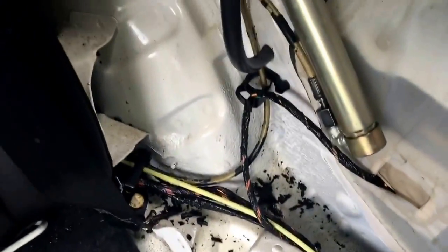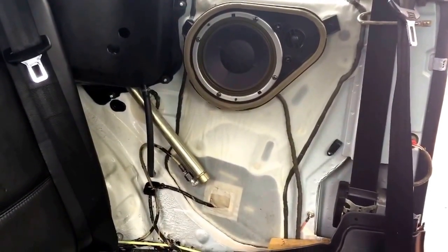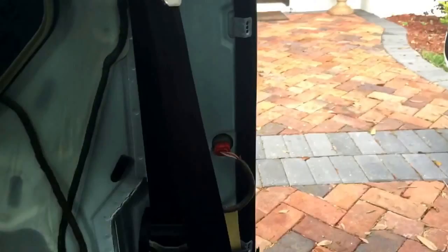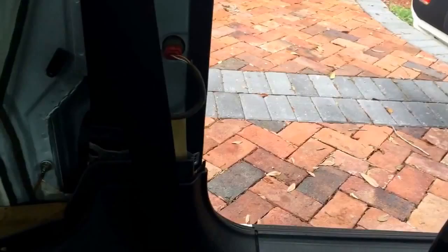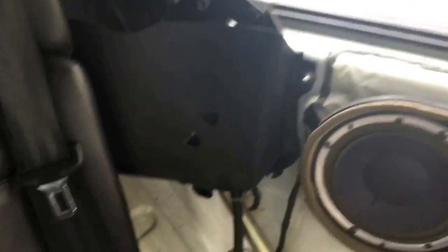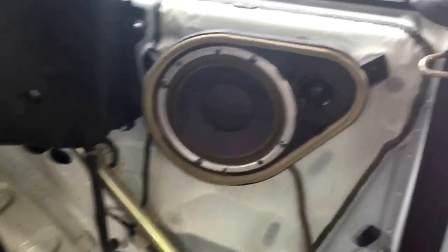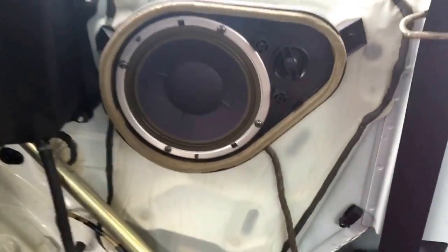I cleaned it up since I found it. After you find which side the leak is on, you have to take off the rear panel, which is pretty easy. There will be two screws — one here, one here — and a couple of clips around, like one back here. You have to fold the seat down and there'll be one right there, and there might be one right here held with a screw, and then some clips on this part which you just pull out.